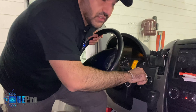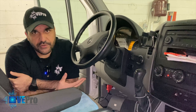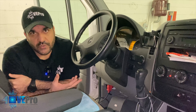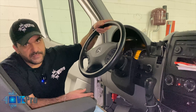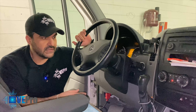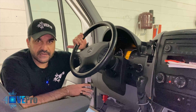The vehicle will always start now and will never shut down related to the steering lock. We recommend actually removing the mechanical steering lock system for safety purposes. The advantage of using a bypass module is you never have to worry about this failure again, since the original electronic steering lock motor weakens over time with use. However, keep in mind that with this solution the steering wheel will always be in the unlocked position and will never lock. Advise your customers of this, and also suggest notifying their insurance company so they're aware this was installed to solve the original problem.